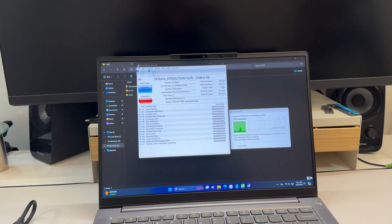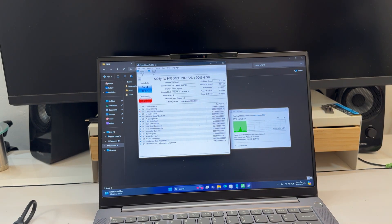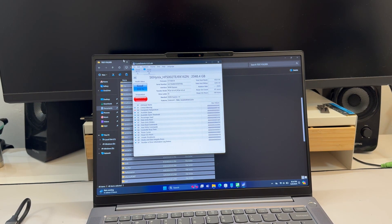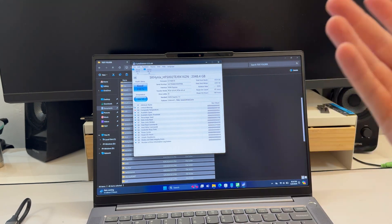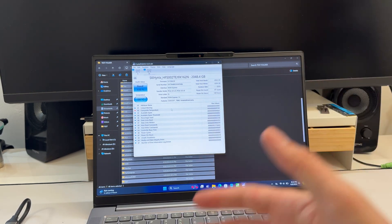After a bit more time, doing a refresh — most of these drives I'm not sure why this warns at 61, because most drives are supposed to operate under 70, 71, or 72. So we'll just see. Now I'll stop the write and do the opposite — pull stuff off the SSD to test reads. The second it finished, the temperature went down. Under maximum load — writing and reading — it sits at about 63-64°C, which is absolutely blasting it.